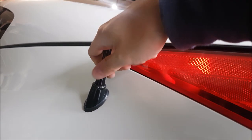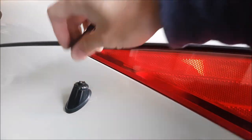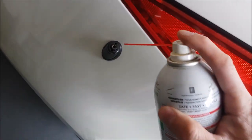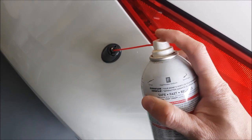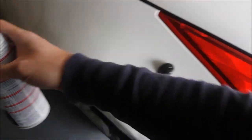So if you're going to take off your antenna, it's just threaded on whether aftermarket or factory — just twist it off. Now if you're noticing a little bit of corrosion there, I would just spray a little bit of some sort of penetrant lubricant. I'm using Deep Creep.